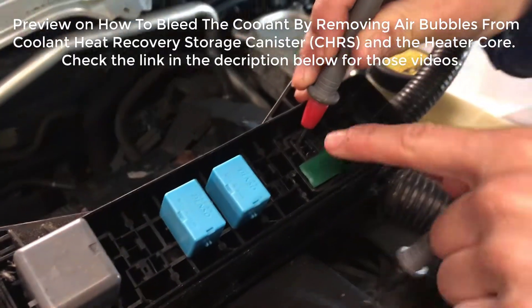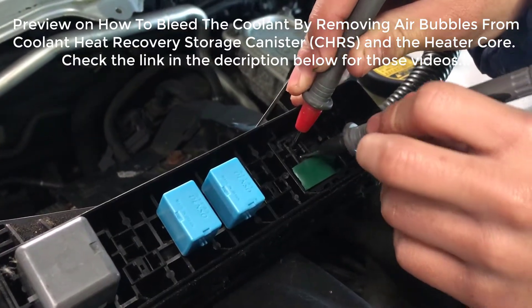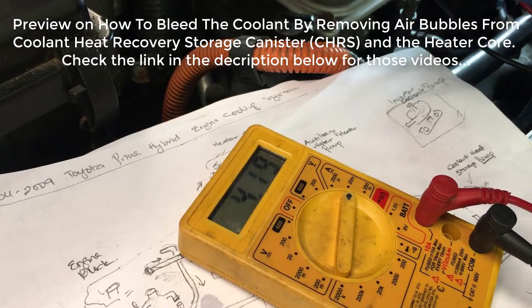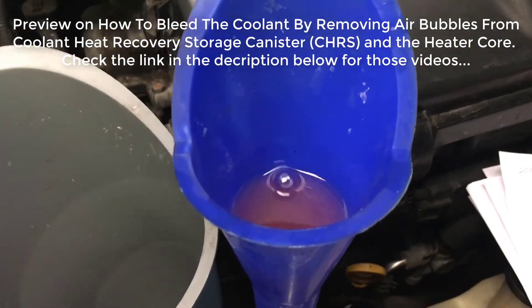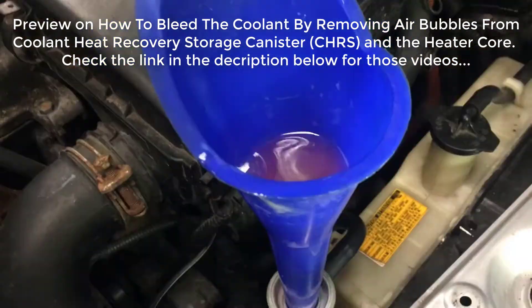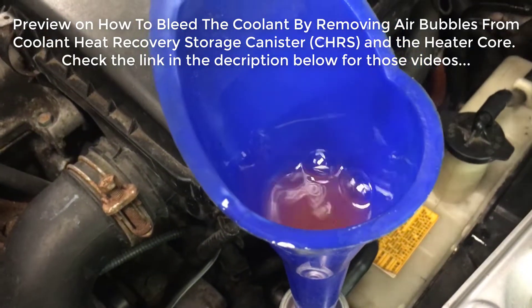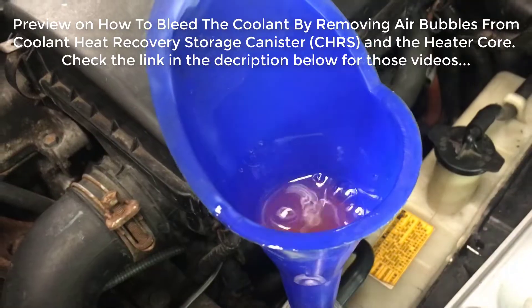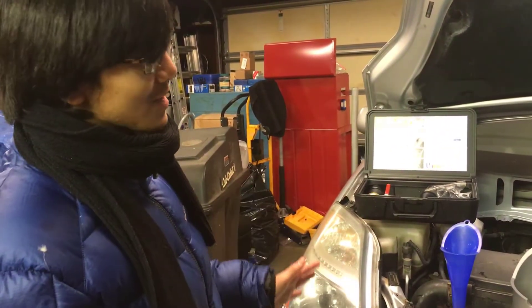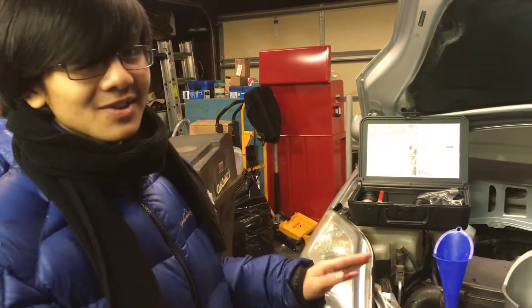Right here — we put this green tape just so I don't put it in the wrong hole. You can hear the pump is working. We can detect what the amperage is. You can see that air bubbles have come out of the system because we jumped the pump. Now that we've turned the engine on, you can see air bubbles are coming out from the funnel. I'm Ayman — thanks for watching. Like and comment, subscribe, and check out our videos on the Toyota Prius, especially that purging video, because we're doing a lot of videos on this car.